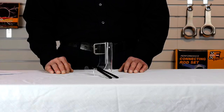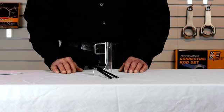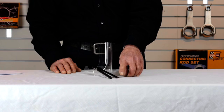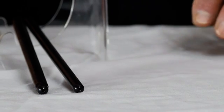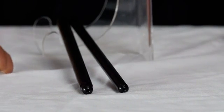So we have an approach that we think is the best solution for engines that oil through the pushrod. Our R-Series 4130 pushrods feature a 40 thousandths of an inch hole on the rocker side that keeps full oil flow to the vulnerable lifters while limiting what gets to the top of the head. Available in 5/16ths and 3/8ths inch diameter.